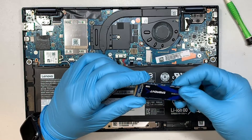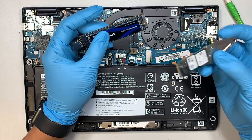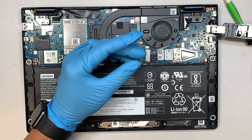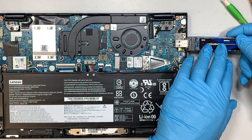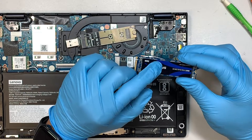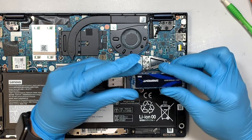There are a few ways you can handle this. Option one is what I call cloning the hard drive. Before you disassemble your computer, get a USB adapter and the new hard drive, stick it into a USB adapter, and do a cloning process. You clone everything from the old drive over to the new drive before you install it. Once cloning is done successfully, everything — your Windows, your data, your settings — will be transferred and look identical on the new hard drive.